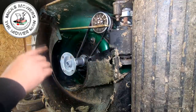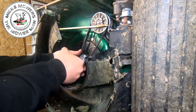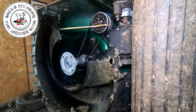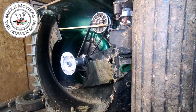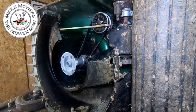Once it's in place and your spark plug has been removed, you can then literally just put your thumb, a bit of pressure, and you can then turn this engine with your dead man's handle in, of course, because it won't go nowhere with an engine brake on. Let me grab a clamp and put the old engine brake on. I'll take it, you know, so it's activated. That way the engine can't start, but we can freely turn the crankshaft, okay? Without doing that, you're not gonna go nowhere.